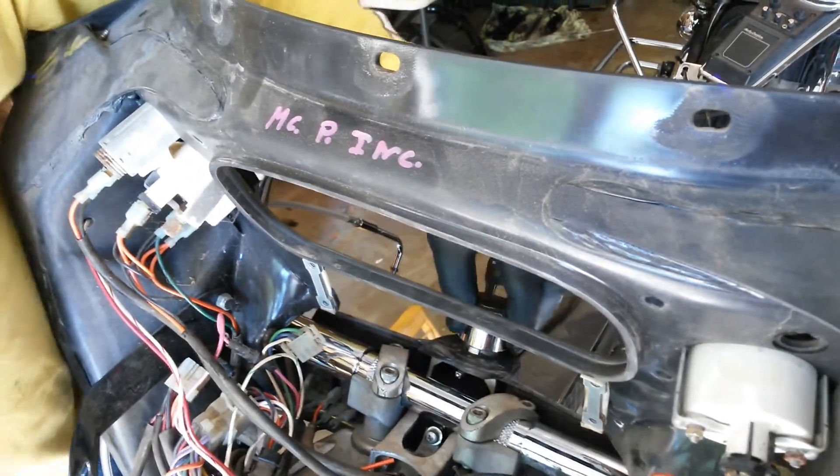I've got it on lock here — gotta unlock the key — then everything works. So now you know these bikes are totally different. If you run into one that does not have the indent button, you have to pull your front fairing, pull your instrument panel, pull your radio — it's underneath the front fairing, underneath the ignition. This is on the 1992 Electra Glide Ultra Classic. Thank you very much, come see me again.